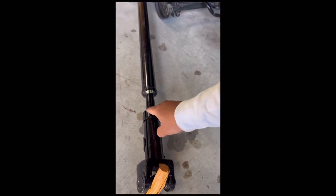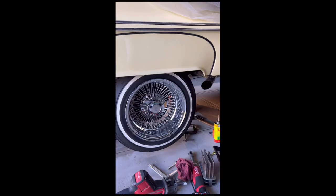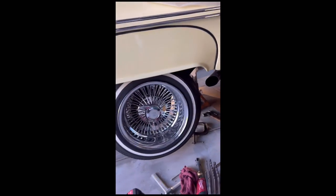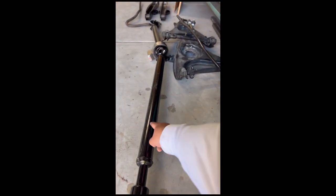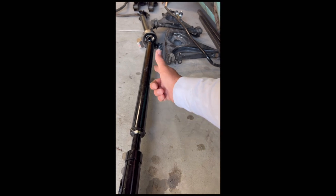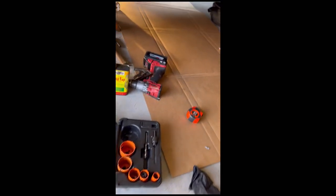I already had an adjustable rear yoke going to the rear end because of the up and down motion from the airbags. But now with the hydraulics, the lockup is really high. Before I used to go only up to about half of the knockoff, but now the lockup goes pretty much up to the whitewall. That bent my driveshaft, so this is the new — well, repaired one. I got it repaired at General Driveshaft in Monrovia. They do really good work, balanced it for me and everything.